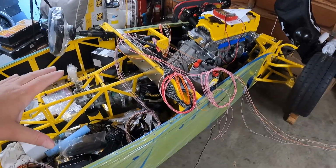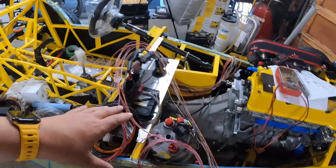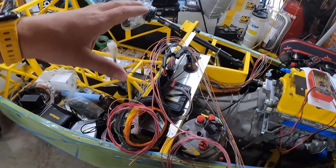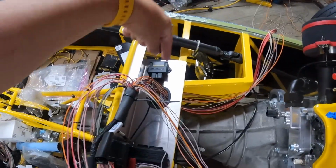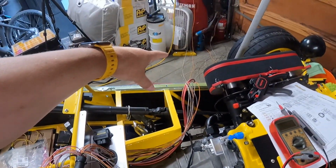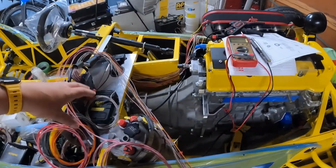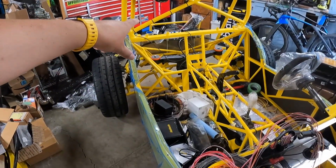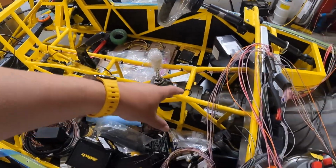Back out of time lapse now, making a little bit more of a mess, but you saw me start to route some of these wires around. So the method to my madness is this branch, which comes down through the grommet and off to that side of the car. That's going to be routed forward through the engine bay. This bundle is mostly destined for the back of the car, the rear of the chassis, but also includes things that are going to be stopping in the tunnel.